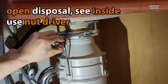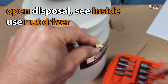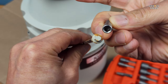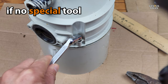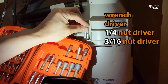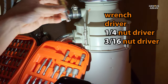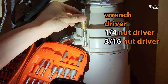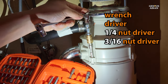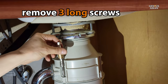This disposal was being held together with three very long screws. To remove the screws, you need to use not a screwdriver but rather a nut driver. The top of the screw is in a somewhat awkward position — neither pliers nor a wrench driver would fit at the lower point. The screw itself is not all that tight, but in order to move it at all, we had to build up a device using two nut drivers and then using a wrench once the height had been raised.